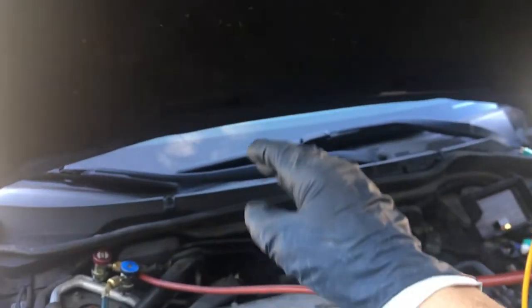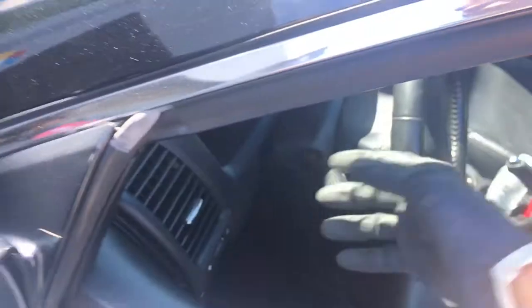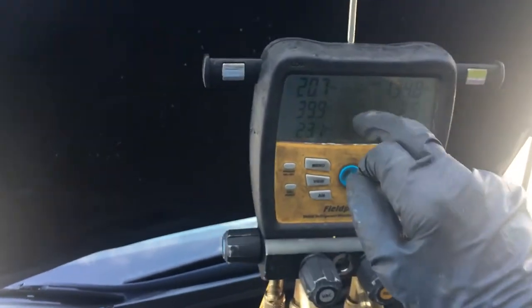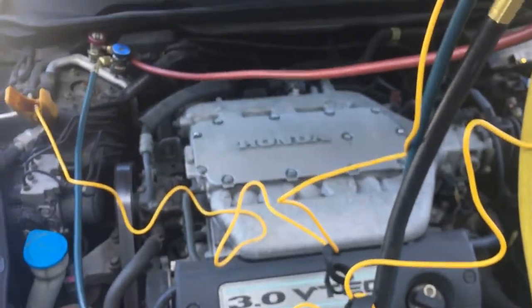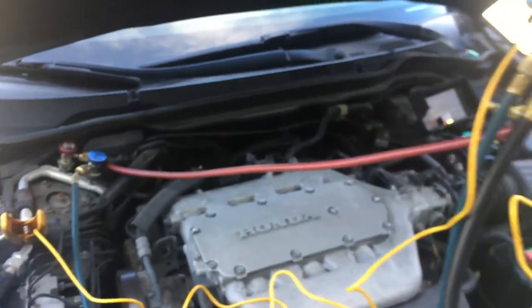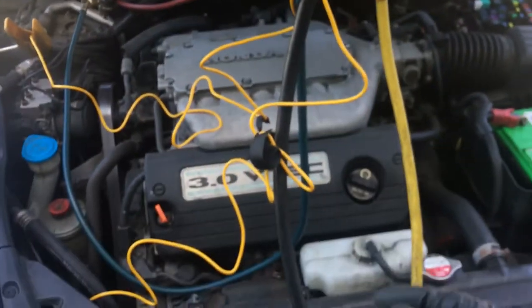There is a circumstance with your superheat where you could get ample cooling out of the dash but have no cooling going to your compressor — the compressor starts overheating and breaking down the oil. We're nice and cold at the dash, but I know it's low because the superheat is way off. You need a cold gas delivered back to the compressor. The manufacturers of AC systems are not Honda, Toyota, Ford, or Chrysler — it's a third entity that they buy from and install in your vehicle.